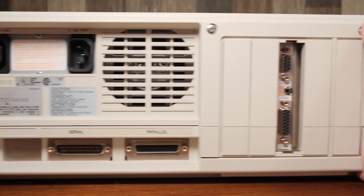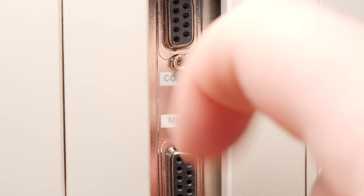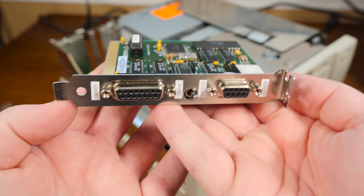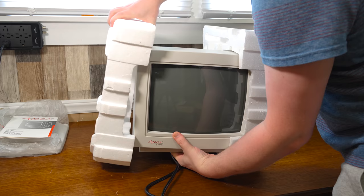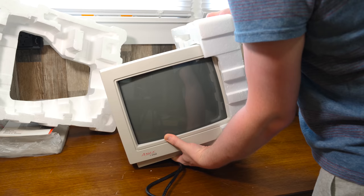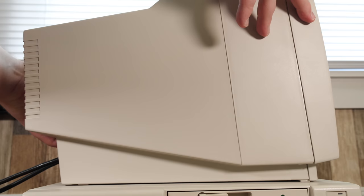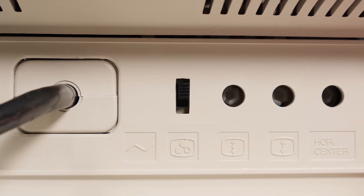What is impressive though is the graphics card, featuring a 9-pin video port and a 15-pin game port for joysticks — making for an unusual combo. There's also a toggle switch labeled color and mono. Epson called this their MGA card, or multi-graphics adapter, being that it supports both RGB color and TTL monochrome monitors, outputting CGA and Hercules graphics respectively. The RGB monitor itself is pretty awesome too, with a clean design matching the rest of the system and an etched screen surface to reduce glare. Around back there are some adjustment pots, as well as a switch for color and monochrome, similar to the graphics card.